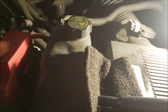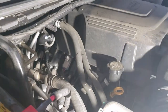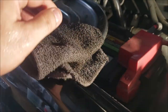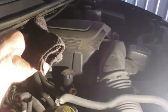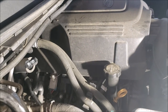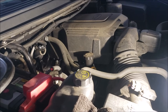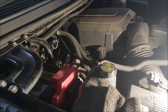One other tip: ATF is kind of messy, you've got a really long dipstick and it's a full arm's reach back. What I do is use one of these black funnels and a rag. I use one rag to wipe off the dipstick, and when I take the funnel out I stretch my arm so it doesn't drip anywhere. I set it aside while I'm checking, then when I go to put it back in I put the rag on the end again, feed the funnel back in, top it off, and repeat until it's where I want it.